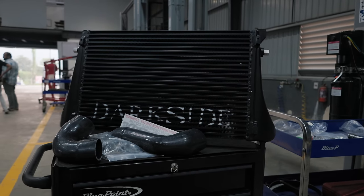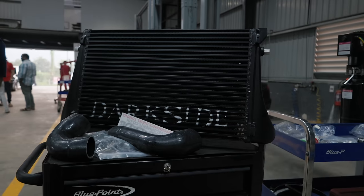The car has gotten a hell of a lot more consistent power. It's just so much more alive, it just wants to go now. Whereas in the past, after one or two pulls, the car just felt dead — it gave no boost, no power, and it used to drink fuel like nobody's business. This intercooler upgrade has changed the whole experience and it's definitely more consistent when it comes to power. As for fuel, I'm pretty sure that will also improve because once your car gets heat soaked, what the ECU does is dump fuel into your block — petrol is also a cooling agent, so dumping fuel helps control engine heat. I think that is going to get reduced as well.